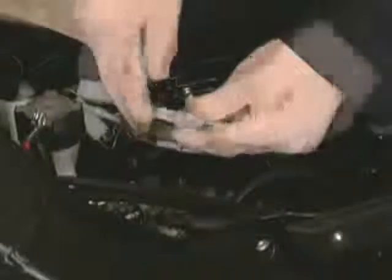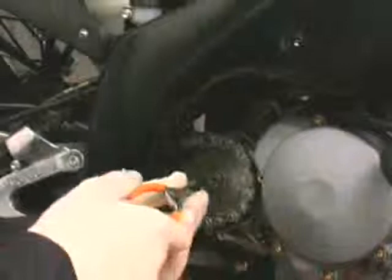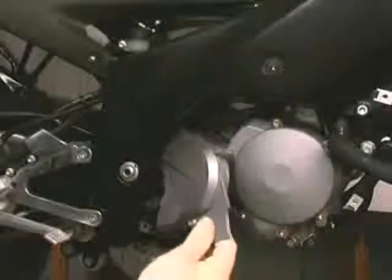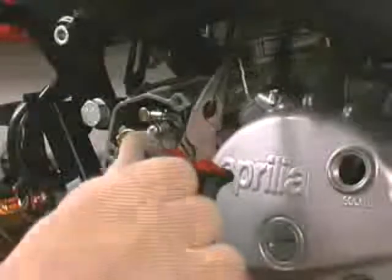Pickup. Generator. Starter motor. Fit the front chain sprocket to the shaft together with the drive chain. Fit the circlip. Position the sprocket cover and secure it with the 2 screws. Connect the throttle cable to the mixer oil pump.